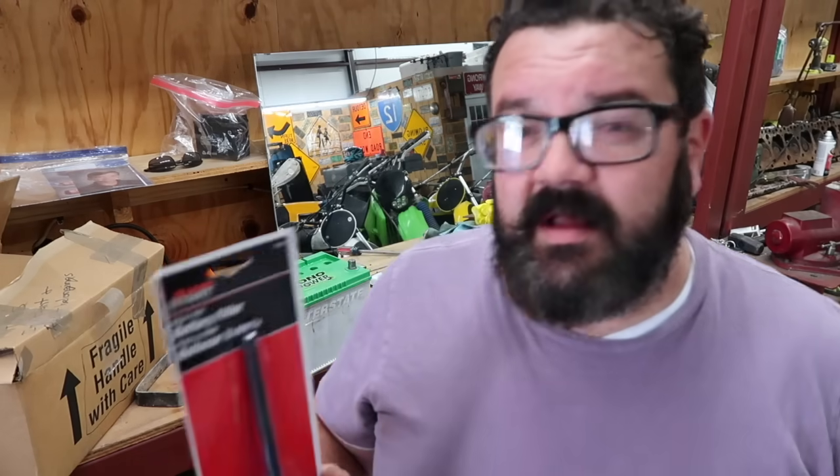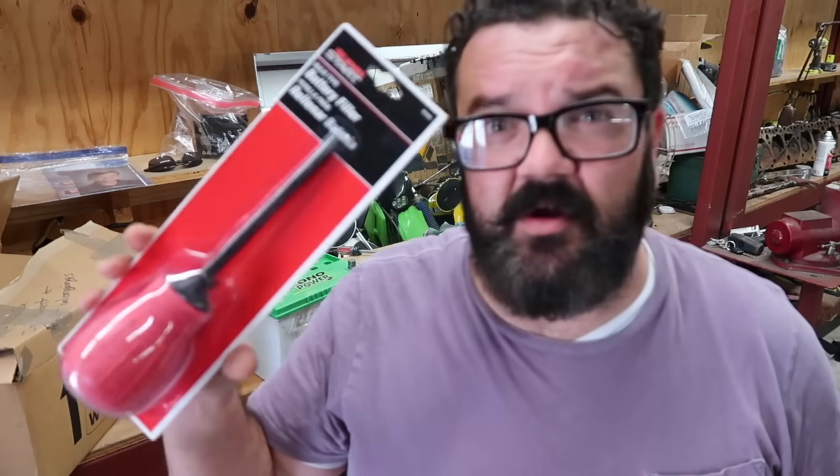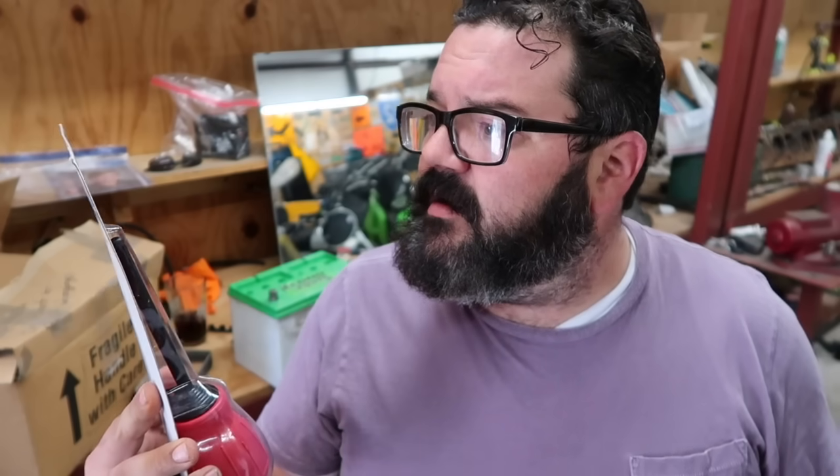If you're wondering about the green battery — all the other ones when I went to drain them kind of chugged out like you were emptying a container and were noticeably empty. The green battery I held it for probably a couple of minutes and it was just slowly dripping out. I don't know if it was the plate design or what, so I decided not to flush that one just in case there was more acid in it. The thinking is that any heavy lead or metals will drop to the bottom and we're not going to suck those up. I've got the Epsom salt and acid mixed together and I'm using this little baster — it's called a Super Start bulb-type battery filler and I got it at O'Reilly's for like five dollars.